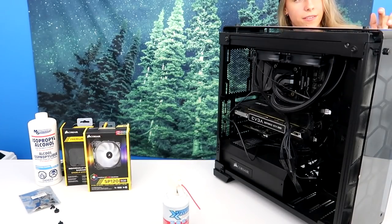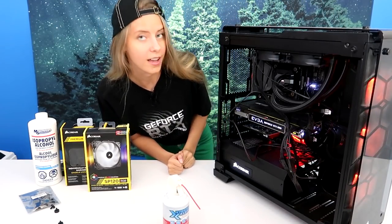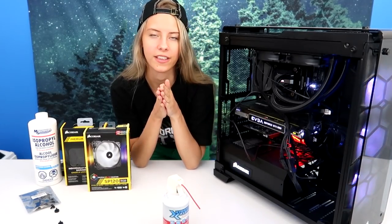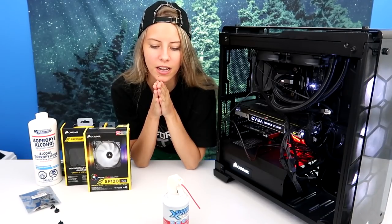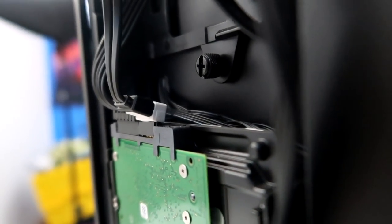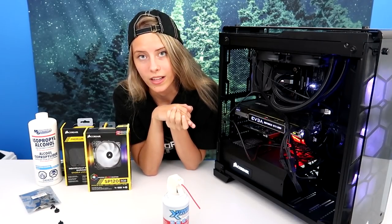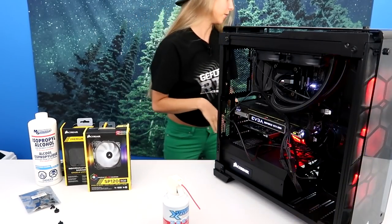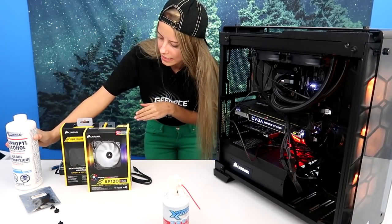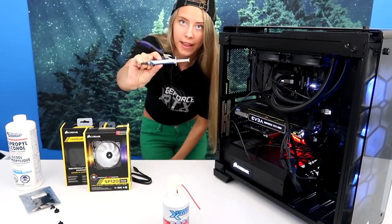Power button, go. RGB fans — amazing. So everything boots up normally as you guys can tell. On the back of the PC is where the hard drive is, and he told me he has issues booting up sometimes. I know why now — he has a SATA cable with a right-angle connection and it's interfering with the back panel, so it's not plugged in correctly. So I went ahead and got him a new SATA cable as well. I also have some more tools: isopropyl alcohol to help clean, wire cutters, my screwdriver kit, and some thermal paste. We are prepared today.